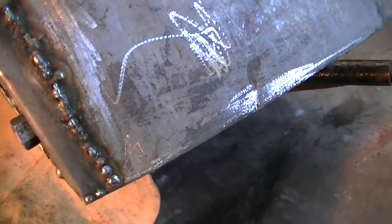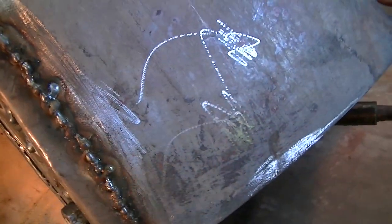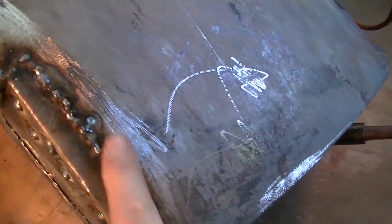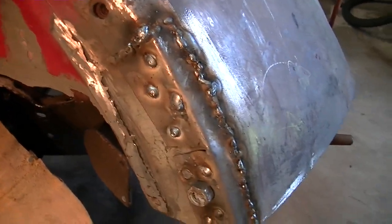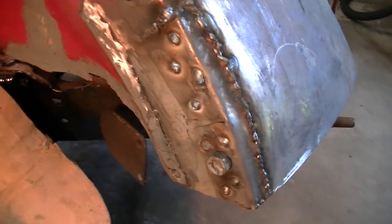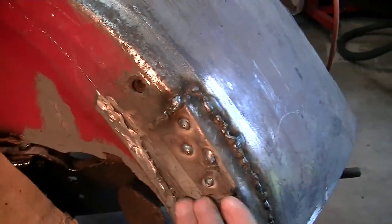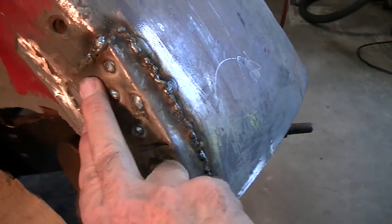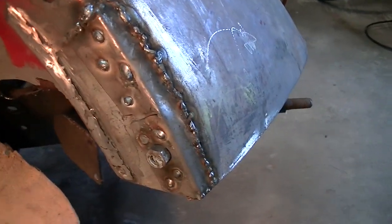Okay, so here is that piece welded along the front. I got really lucky on the settings for this butt weld along here. Backed up by copper turned out to be really useful. Took the copper parts out from the clamps and didn't get such a good weld, so I jammed some more copper back there. And over here's where the piece folds around, and some plug welds into the original patch that was put underneath.